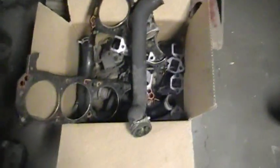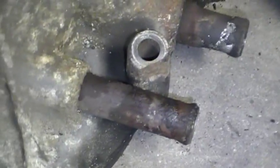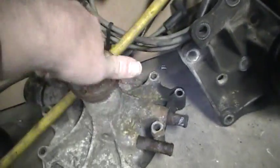There are the old hoses - I'm not reusing the original radiator hoses or the original heater hoses. The water pump has been replaced already, but look how rusty that nipple is, and where the nipple presses into the pump - it looks like it's been leaking there. The bearings are already worn; it spins too easy and should have some resistance.